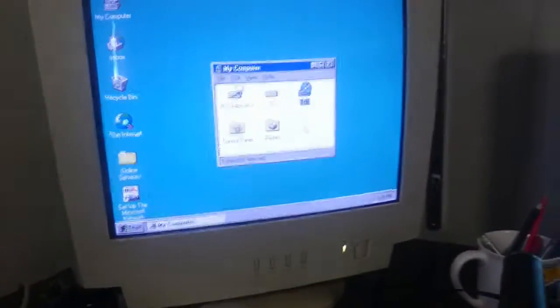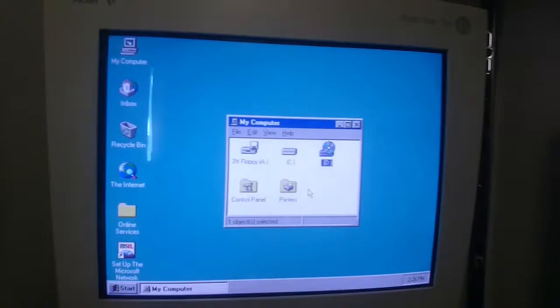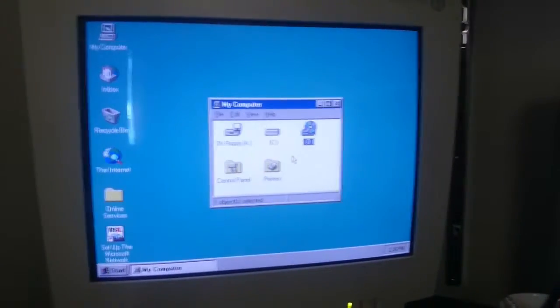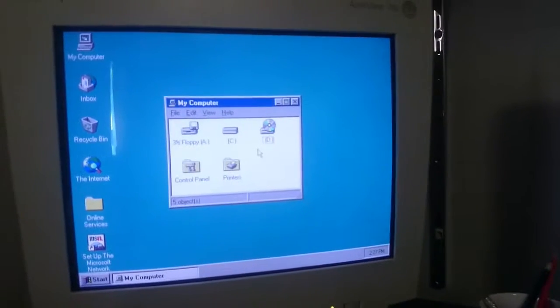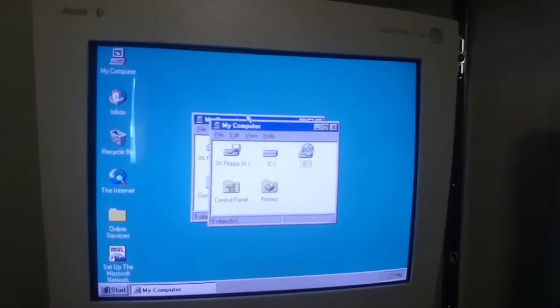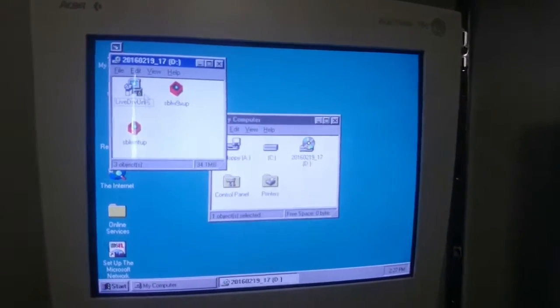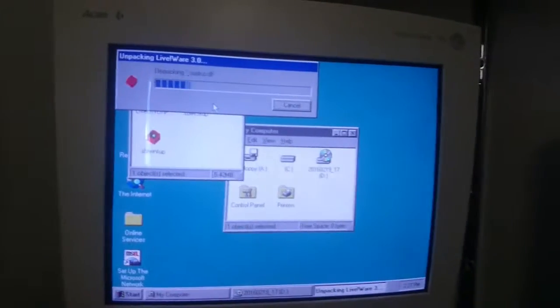I'm now going to do sound card. I've also got a Sound Blaster PCI 16 in here, but the Sound Blaster Live works better, in my experience. The PCI 16 is alright, gives you your basic things, but for the things that I wanted to do, the SB Live does better. So now I'm going to click on 9X, Windows 9X.